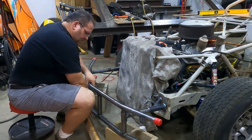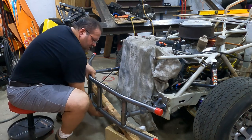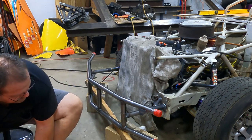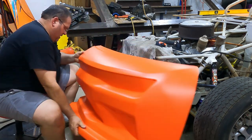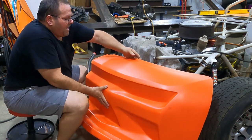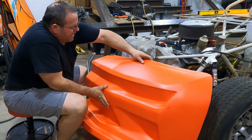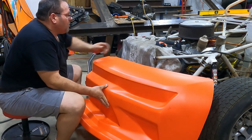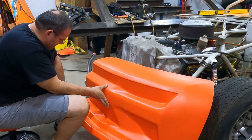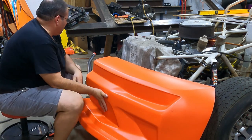This is a three-inch block. Let's go up three inches — I speculate that's probably going to be about what I need. Let's see what that looks like. Now I've got right where I've got that angle, so I'm going to have that roll and come straight up and hit that radiator right there. I think that'll be fine. That gets me to about eight to nine inches right here on the front to the ground. That's probably a little bit more realistic.